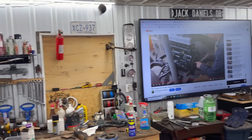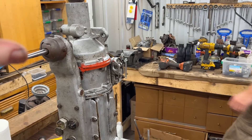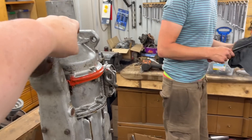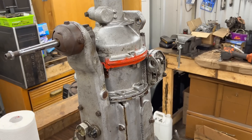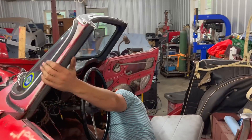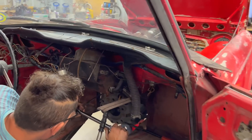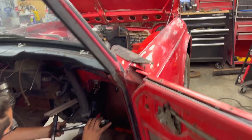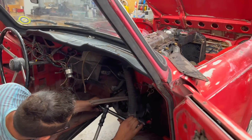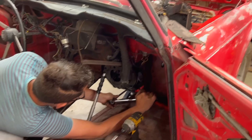Thursday at the Rusty Beauties shop and we've got the overdrive ready to go. We actually split the case because of a significant oil leak from the rear at the brake ring, RTV'd it, and this is just the excess that squished out. Alin's got the clutch in and centralized, just torquing down the bolts to 20 foot-pounds per the manual. We're hoping to get the transmission back in place, which will allow us to get rid of the 2x4 holding the engine up.